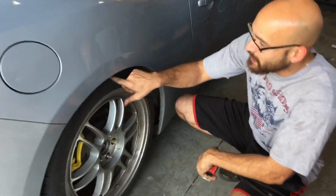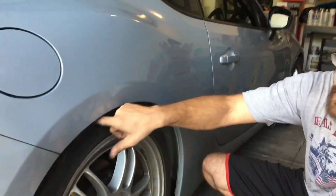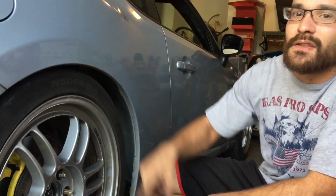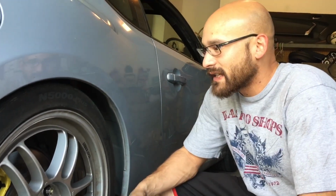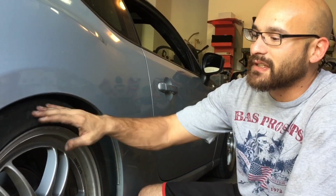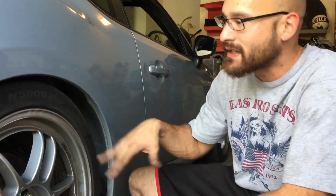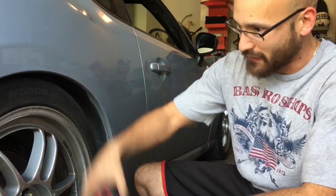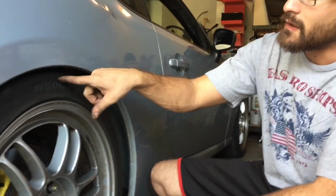Next thing that we're gonna tackle is ride height. So now if you come with me, start off with the back. The back, we might just leave exactly where it's at, because if you see here, come squat a little bit, we have it more or less tucked with the tire itself. Normally I like to go a little lower than that, but for right now, since George is semi-new to dropping cars, there's going to be enough ride height clearance, but I want him to be semi-stance, in a conservative stance, you know, no stretch, no fitment poking out or whatever. So we're going with a flush fitment, square setup. We're going to leave it like this.